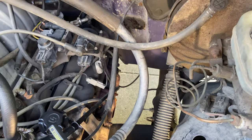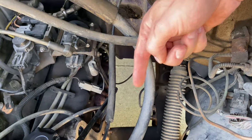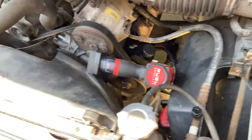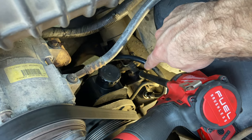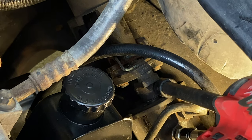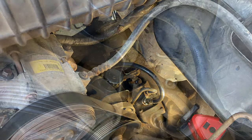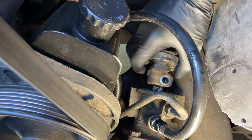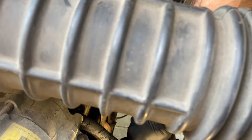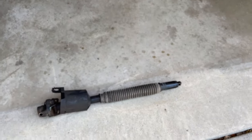Now we're on the engine bay side of the shaft. I pushed the remainder through the firewall — it's loose under the boot on this side. At this point we have to unbolt it from the steering box. The nut I'm pointing to holds it onto the splines at the end of the shaft. Let's unbolt that. With the bolt all the way out, you can pull it right off, then slide it forward and work it out. There's our stock steering shaft.